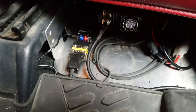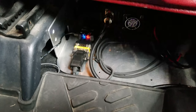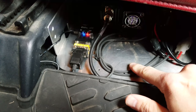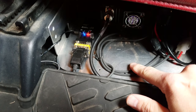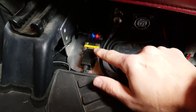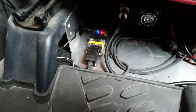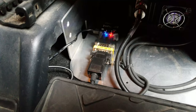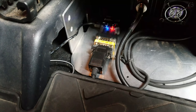Here I have the radio mounted on a bracket under my seat. I have the DB9 cable for the radio — I'll link to that part number in the video description. I have that connected to a 9-pin gender changer, which is then connected to a Bluetooth serial adapter. I'll put a link in the description to that adapter that I purchased off Amazon.